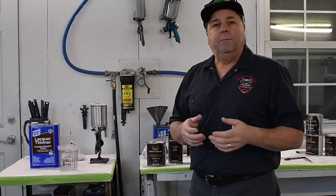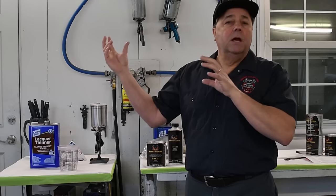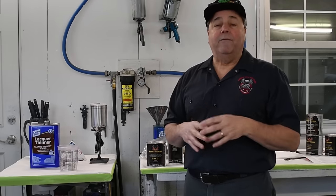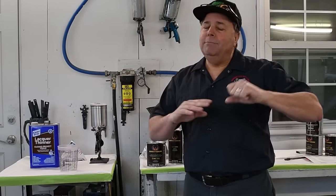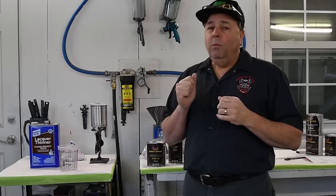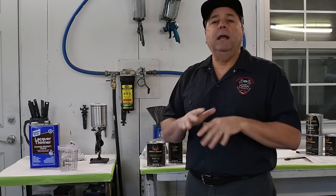But regular people might have some fans, some exhaust fans, and some heaters that blow air over the surface, and you might end up with a situation where you have uneven temperature on your parts. So some areas may be dry, and then maybe off in the corner or down low or something, it might be cold. Be aware of that, because this clear dries slowly and flows out.